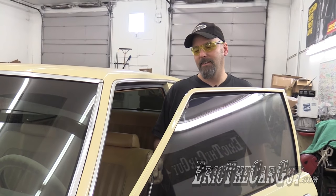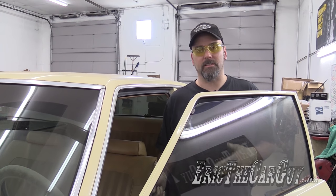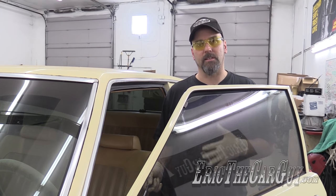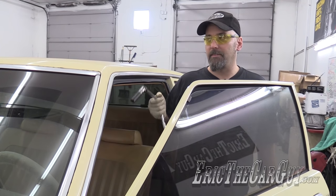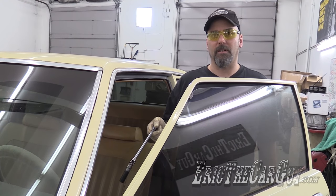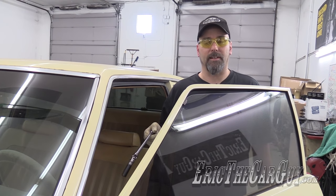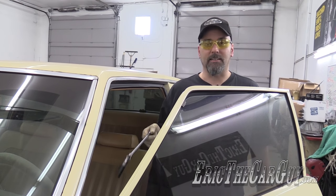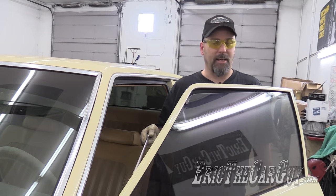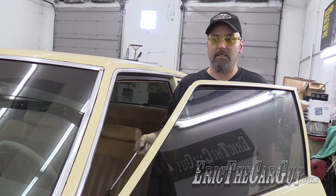Things have taken a turn. We figured out the master cylinder is bad - it's not sending any pressure at all to the rear wheels. I think it was old and rusty on the inside, tore up the seal, and it's sometimes sending pressure and sometimes not. I'm done going insane. The determination is made that the master cylinder is bad. The 86 Mustang has a master cylinder with power brakes; this Fairmont does not. They don't quite fit. So now I'm going to fit the new master cylinder to this whole system, taking the brake booster out of the 86 Mustang with the new master cylinder and putting it into this. I just want to hook this up so I can go for a drive and try out my new rear end.